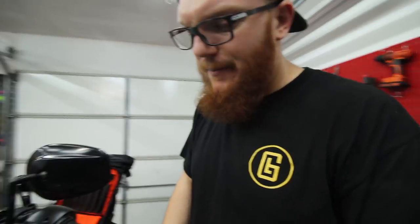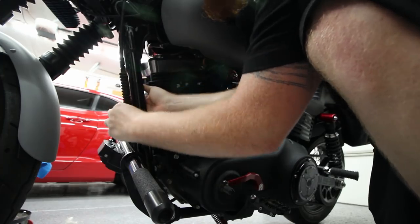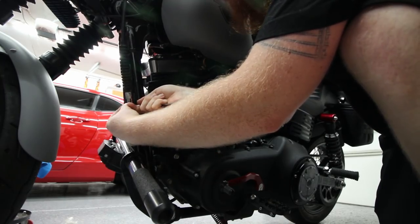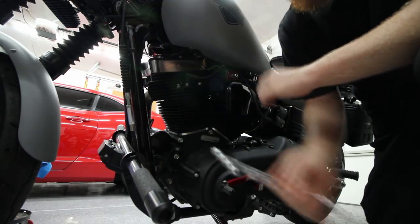I've got my list going on my phone and I'm going to get sizes. First I'm going to focus on the clutch cable — the adjustment is down at the bottom underneath this little boot here. These are two different sizes: the top and bottom is a half inch and a nine-sixteenth for the clutch. Moving up top to the throttle, you have your basic two-wrench system — both are three-eighths.